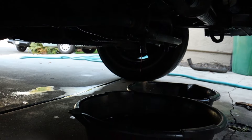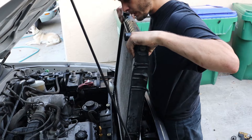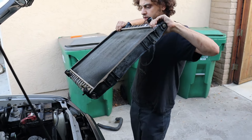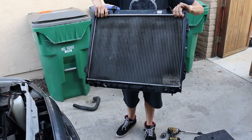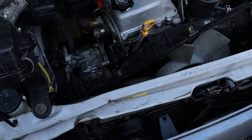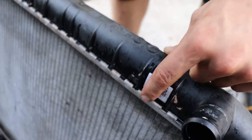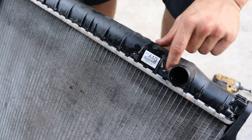Now we're going to pull the radiator up, drain it a little bit — there it is. And it's even twisted from an accident — that upper radiator support got twisted a little bit actually if you look at it. That's probably why it cracked; it was under stress and it's old. It's cracked right there — you can literally see a little hairline crack, and it was leaking.